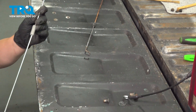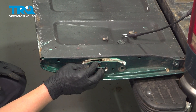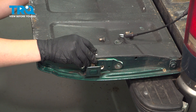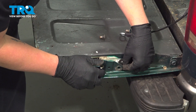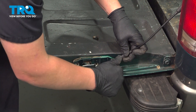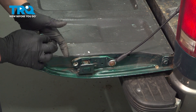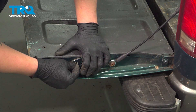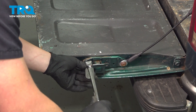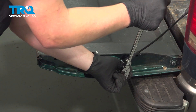Install the new rod and install it into our tailgate. Be sure when you put this in that you can see the rod through the handle. Reinstall this washer behind this hinge. Install the bolt for the cable and the two bolts for the latch. Snug them all down nice and snug.